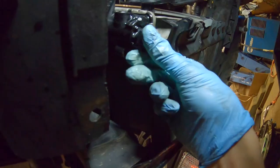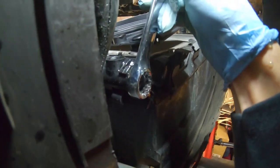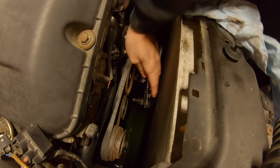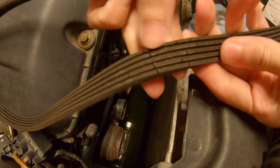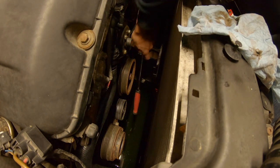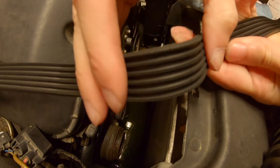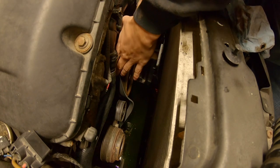Since there's an O-ring I'm just going to dunk the new plug in coolant to get it lubricated. Give it that little turn till it stops — there we go. I'm not putting any extra force on that, it's locked in. The belts are extremely simple on these cars. Just put a T50 in there — pops right out. The AC belt was definitely cooked. This belt is off too. The accessory drive belt wasn't that bad, just tiny little cracks in it, but it's good to do them both now. For these belts and that little drain plug bung, it was $29 — add that to the budget.